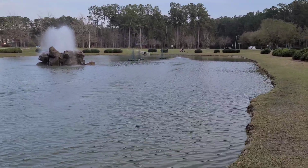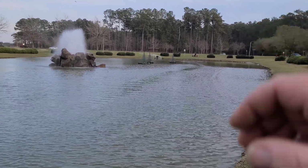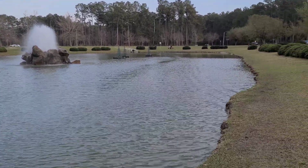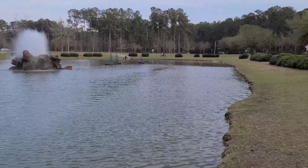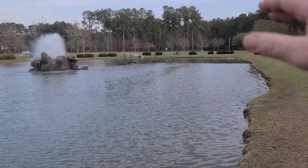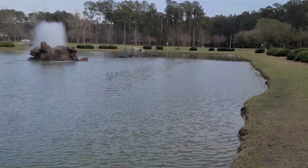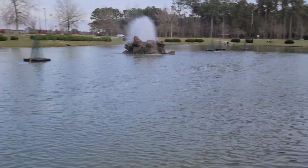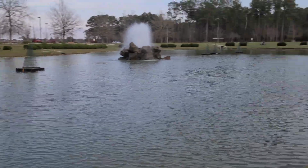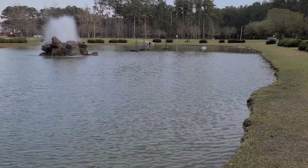It's a high kV, but this is a 40 millimeter 6-pitch prop, and it's round ear, so the temps have been good on 6S with this prop. That's why I've been testing the boat with this prop, kind of getting a baseline to see what the boat does on 8S. So all right, it's windy today. Watch the fountain, man. It's blowing all over the place.